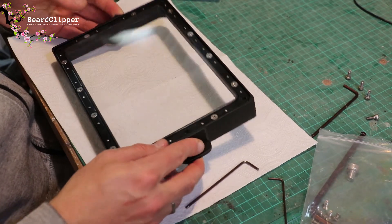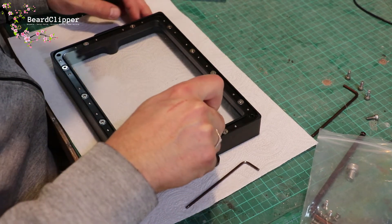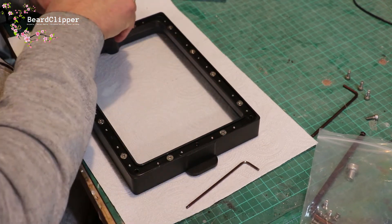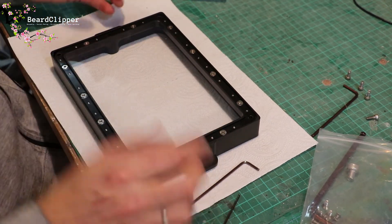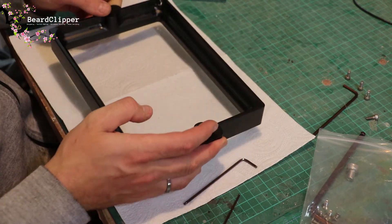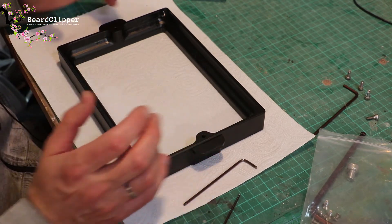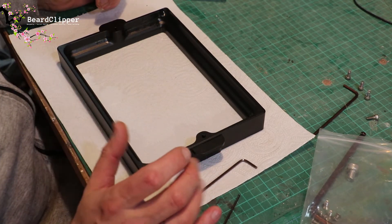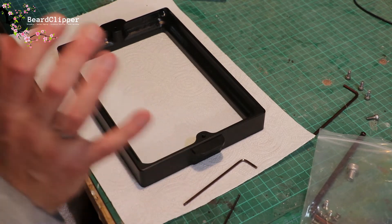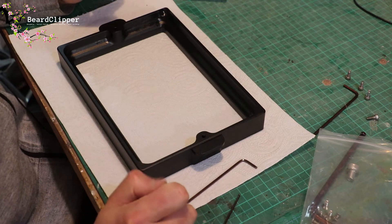There we are — it has been swapped. The only thing left to do is pop the FEP between here and here. This is something you'll only do on the Saturn — this is where the build plate is actually held in onto the printer. We've swapped the FEP. It just takes time. It's not a scary thing to do — a really simple process with lots of repeated actions. Just take it apart, carefully wash it, put it back together carefully. If you take your time and don't feel pressured, then it's not something to be scared of.